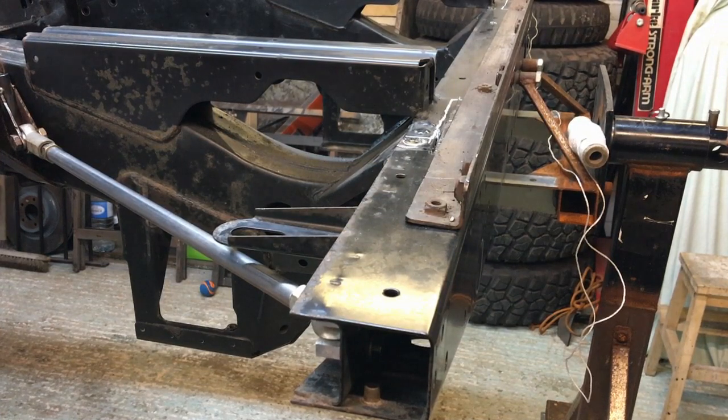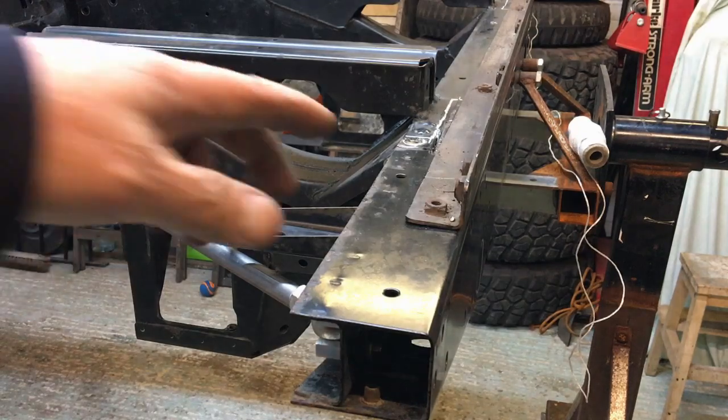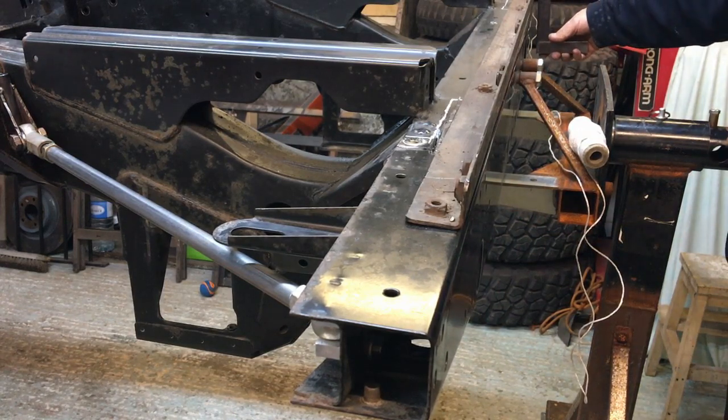Well then guys, here we go — done one side, cut one side, not welded anything, but there it is jacked out in position. Just look at how this beam sits now. This L-shaped bracket runs the length of the crossmember and this is what the body bolts to through here. If you remember, Land Rover used to weld tabs onto the crossmember to attach the body, and obviously they decided to stop doing that — which allows them to make the crossmember like a banana. That's why they now have this bracket. If you follow it along sort of up to the centre and just past the centre it's flush all the way down. I'll grab a straight edge and show you — it's actually flush with the back of the crossmember all the way along, but get down to here and you can see there's a massive gap where this end of the crossmember is turned in. That was the objective of the exercise. I've also got some string here — you can see as it touches here, we've got it nice and straight now.